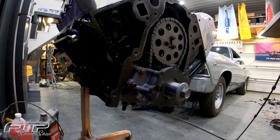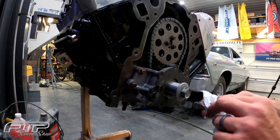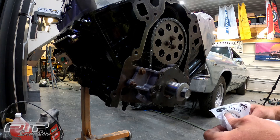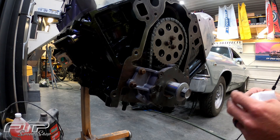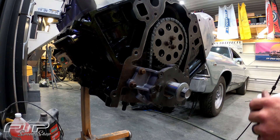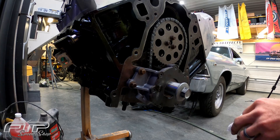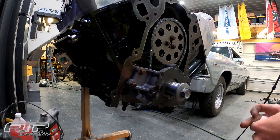With the three different springs included, the red is already installed for higher pressure, but I'm going to go ahead and install the Copo spring because of the boost application. I feel like a little more oil pressure to my bearings isn't going to hurt anything, so we're going to roll the motor over and get to that plug so we can get that spring swapped out.